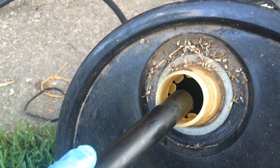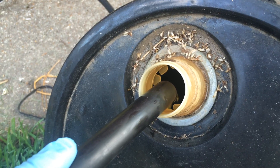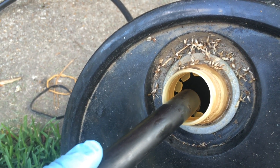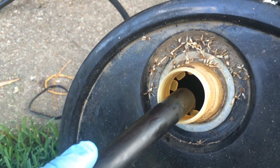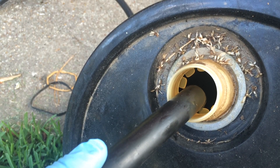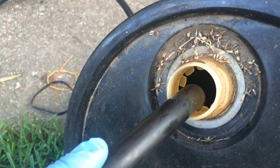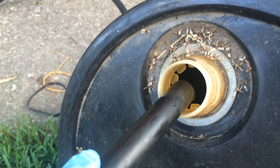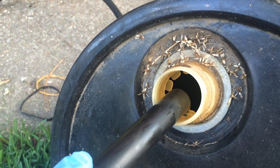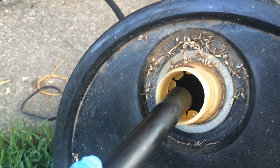I was confused, couldn't figure it out. Luckily I managed to pull off into a gas station with the thing slobbering and sputtering and barely running, got it full of diesel, had to get it restarted and primed up. I had to sit there at the station feathering the throttle for about five minutes to get enough air out of the lines to where it could hobble home. Since then, every time it gets down close to a quarter tank I've got to stop and fill up.